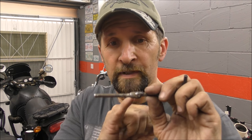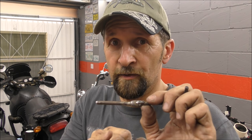You can butcher it, you can try and drill down that, drill really carefully, almost out to the size of the thread, then chisel the remnants of the thread. Honestly, that's an aluminium thread that you're working in. You're just going to cheese it, aren't you? It's not going to last, and then you'll need a new caliper, which is goodness knows how much money.